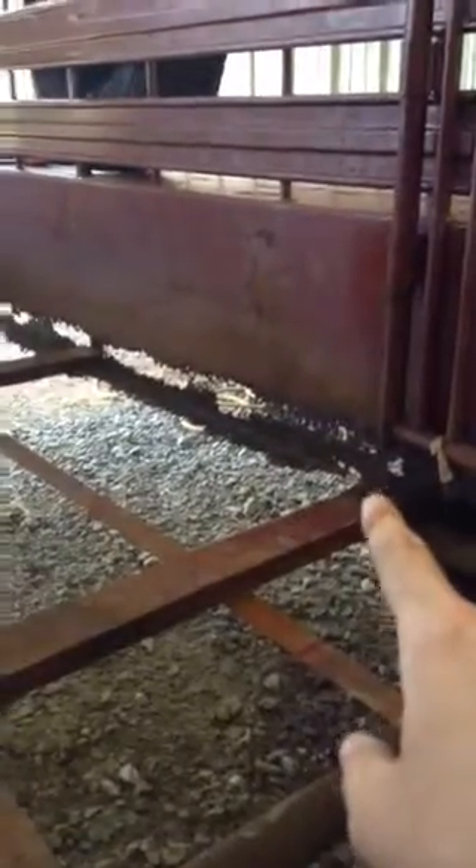I am going to torch out where that piece is rusted, torch that out, and put in a whole new piece that runs from that cross member all the way up to the front. Since this other piece isn't rusted through anywhere, I'm thinking maybe just get some flat bar to reinforce it, and then cut out the section from there to there and replace it with new angle iron.